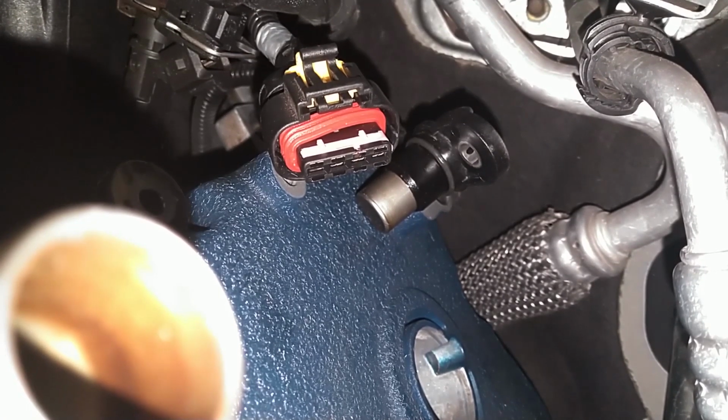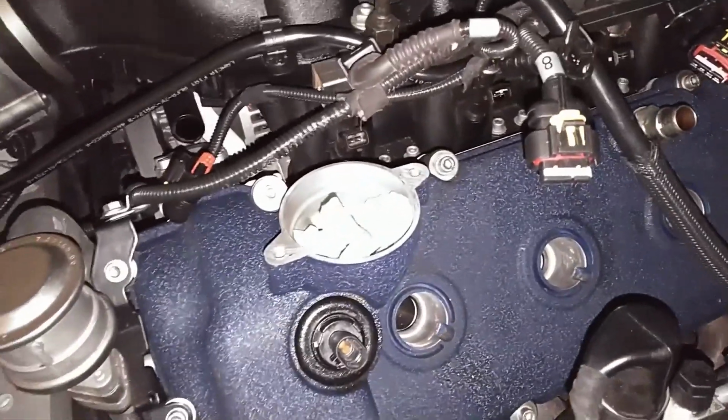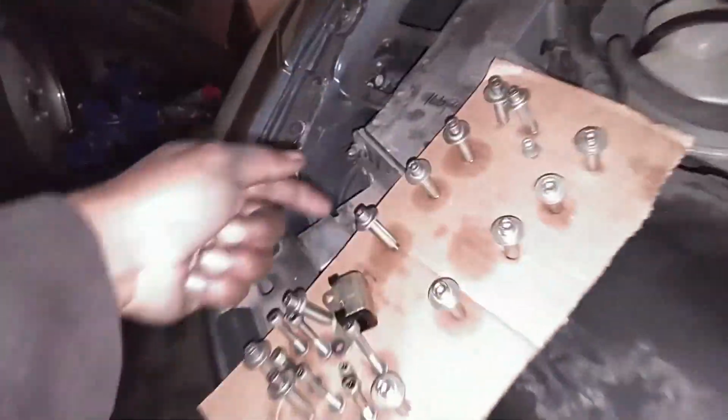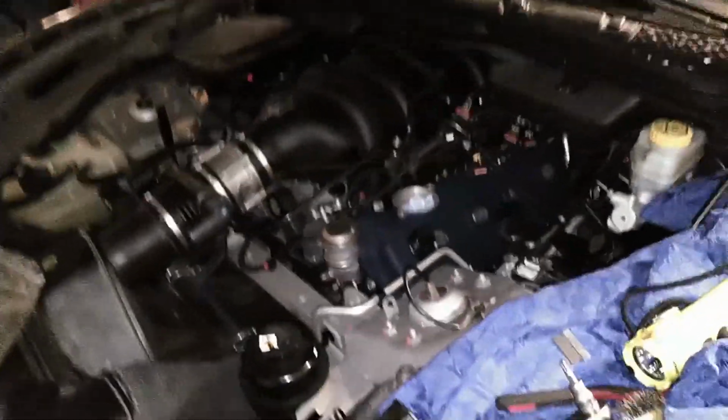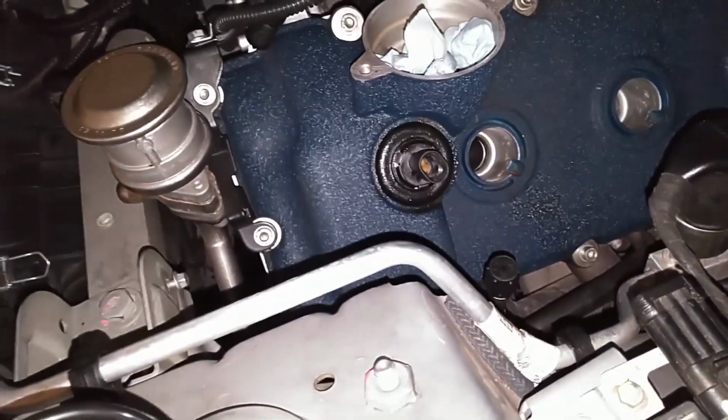As you can see, there's kind of three ridges along your seal line, which is good. Three lines of protection. You want that to be spotless. You may even want to spray it down with brake parts cleaner, or just wipe it down with brake parts cleaner and acetone with a rag after you knock everything loose with a brass brush.